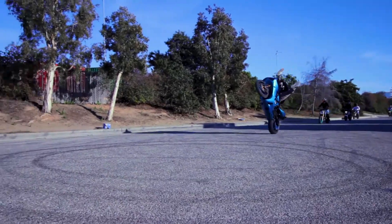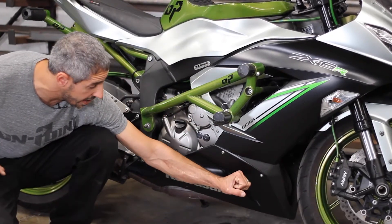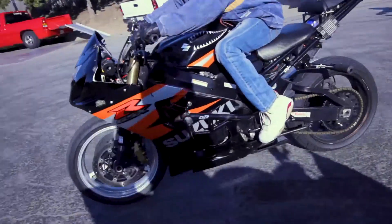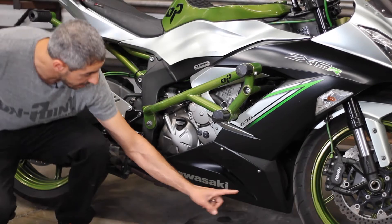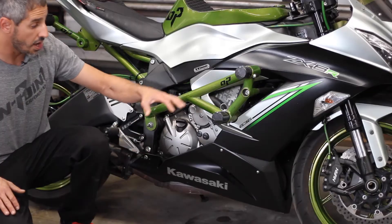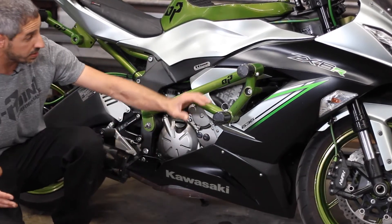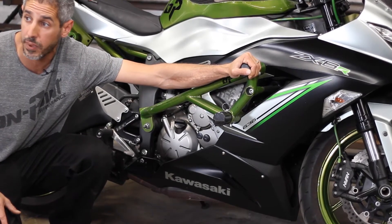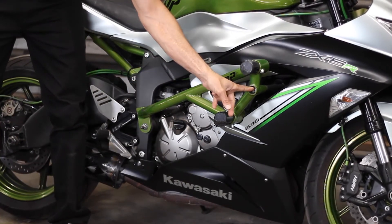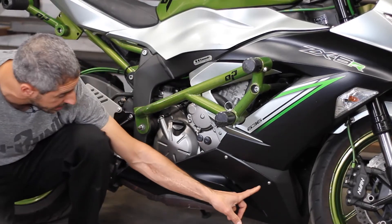While some cage manufacturers try to stick to one cage design — having a slider at the motor mount going down from there — we have found that while that works great on some bikes it doesn't work on others. For example, the 04-05 GSX-R 600 cage is built in that fashion, with a slider up top and a smaller slider there, and the crossbar going through there. But on this bike, having a slider down here would actually help over-rotate the bike, so we need a slider up here to catch the weight if it rolls hard enough. You'll also see that our crossbar is located here for that same reason.